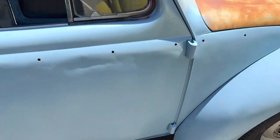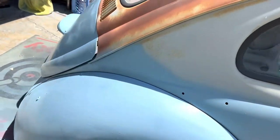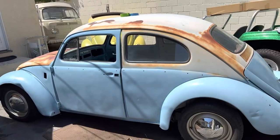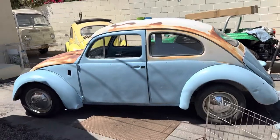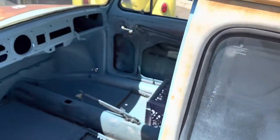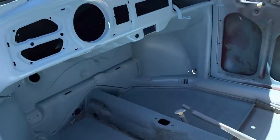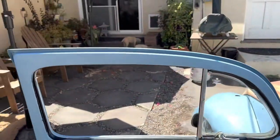After the paint dries, I'm going to hit it with some sandpaper and try to start exposing some of that. Like I said, I've done a real light job and you can see all the flaws in the body. This is not going to be a show car, nor do I want to put 10 grand into the restoration. Even the deck lid's bent. We're just going to cover up this white and patina with light blue. Then I'm going to come in here and seam seal the floors and give it a nice bed liner and put these doors and windows back together.